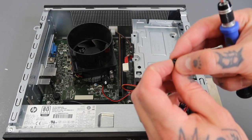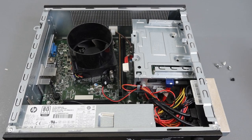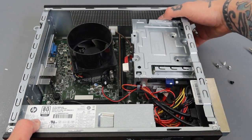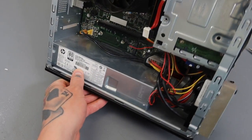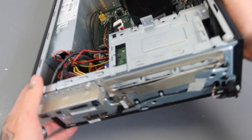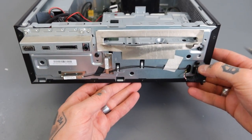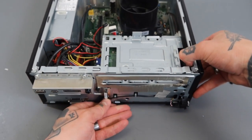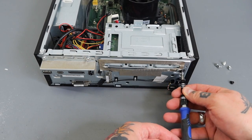I'm going to put the screwdriver in there and get that one. Make sure you have a magnetic tip screwdriver if possible — it's a tiny little screw and it just holds this housing in place. That's all we need to do within here in terms of unfastening the screws. Now we're going to lift this up, turn it over, and there are going to be an additional three screws in the front — one, two, and three — that we need to remove, using the same screw head.